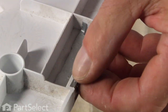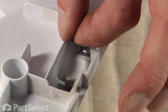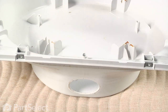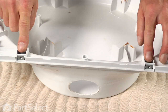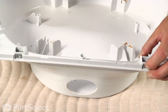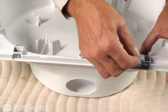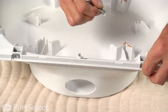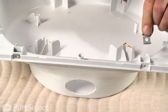Now all that remains is to remove the screw retainers from the inner door panel: pry up on the bottom of them, tilt them up, slide them to the inside, and pull them out. For the two single screw retaining brackets on the bottom, those are typically in there a little snugger. Use one of the other retaining brackets, hook it into the end, pull it out a little bit, pivot it upwards, slide them back, and pull them out.